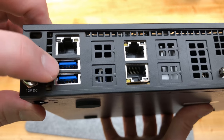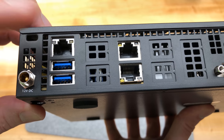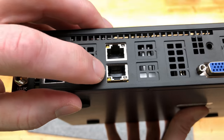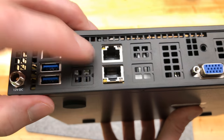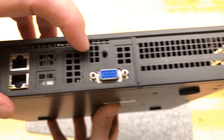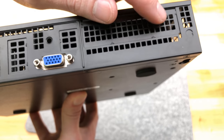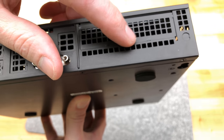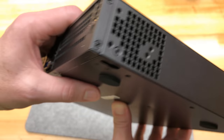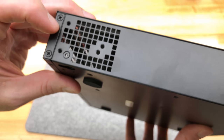Time for a look at the back panel. Clearly we have USB 3.0 with the bright blue connector, power on the left, USB times 2, IPMI Ethernet for management, blank plates, and then a 10-gig and 10-gig — so that's going to be the X557 based on my research. VGA, a metal plate that hasn't been punched out for PCIe cards, and a dimple on the side with threaded holes for 1U bracket adapter mounts.